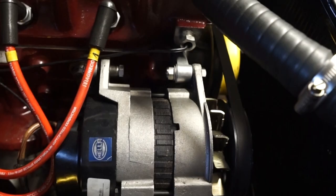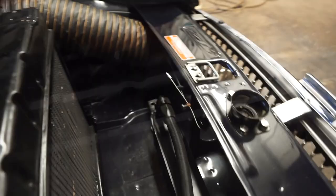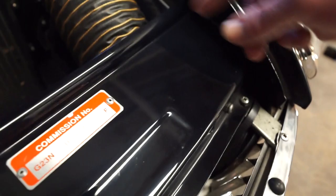The cap itself is vented just to let the gases out. You can see we've got the fuel pressure regulator and a normal alternator - originally the car would have had a dynamo but we are allowed to use the alternator for racing in the UK. There's a standard MGB brass radiator, and at the front you can just see a 13-row oil cooler fitted at the moment. I do have a 10-row one for really cold conditions but nothing larger than that. There's also a little cold air feed for the carburettor - a bell mouth at the front zip-tied into a tube pushing cold air over the carburettor.